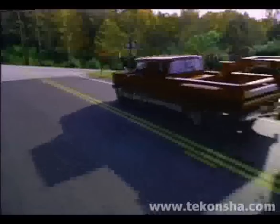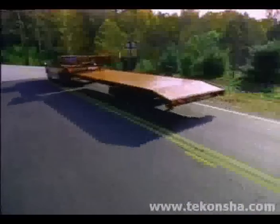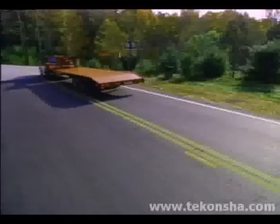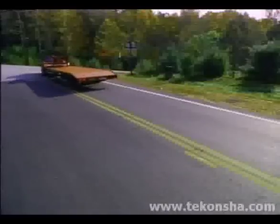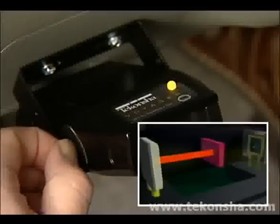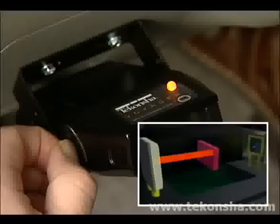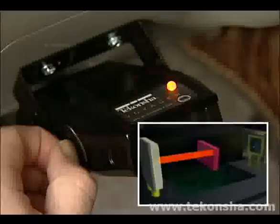If you feel a pushing sensation from the trailer, it's because the opposite has occurred and you have a delayed setting on the sensor control. Simply move the level knob counterclockwise slightly into a more aggressive position. Once this is done, the control is set and should not have to be reset until such a time that the road conditions change or the trailer weight changes significantly.